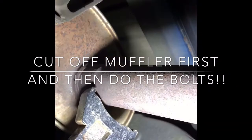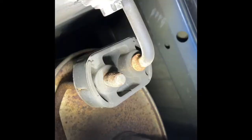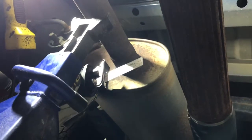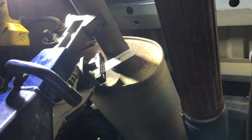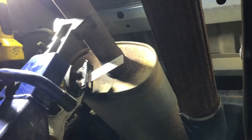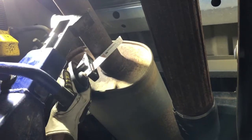We're going to cut off the muffler - cut off the front first. There's a thick part and a thin part; we're going to cut it right at the thin part which is two and a half inches. Then we're going to cut the back of the three inch. We're going to leave the bolts on while cutting so the muffler stays solid and isn't vibrating all over the place. Make sure the cut is super straight so the new pipe will slide right on.